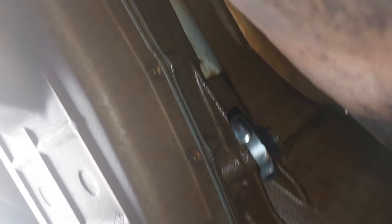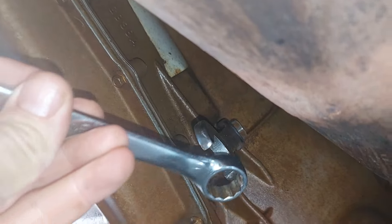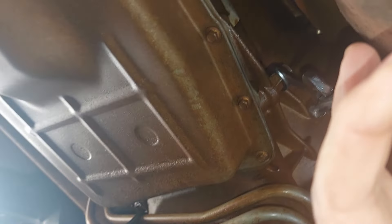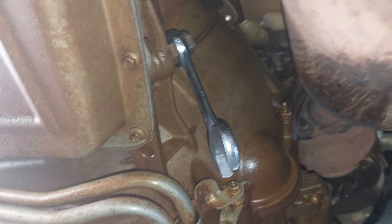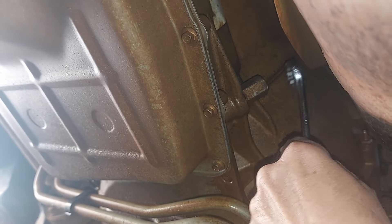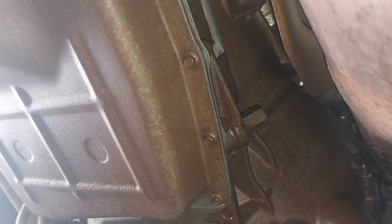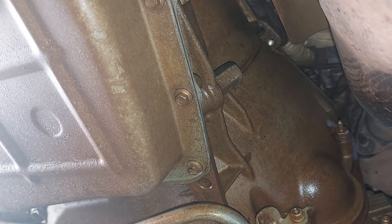Looks like it's a 19 millimeter. I only got a stubby — some of my tools are still packed away from moving after a year, kind of ridiculous. I'm gonna use both hands and break this little tab loose that is just above the front passenger side of the transmission pan. When you're tightening things like drain plugs, you don't have to gorilla-torque it — this thing took a lot of effort to get out. I need to go grab a rag because that is pretty hot.